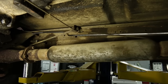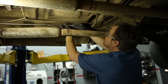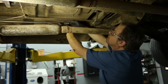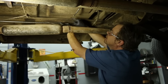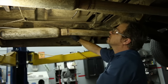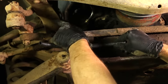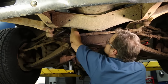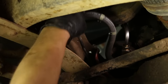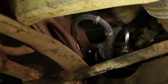We're going to gently slide our new 3/8" line along the rail, feeding it through the C-channel up over the suspension rise. What you want is a nice gentle loop between the hard line from the tank to the delivery line to the pump - you never want your flex line to kink. Just a nice gentle loop and that should give us that. Connect it and connect the other end. With the clamps pre-installed on the fuel hose, we've got enough for a nice gentle loop between the pump and the hard line. Slide it on and put the other end onto the new hard line - now you can see we've got a nice gentle loop with no kinks.